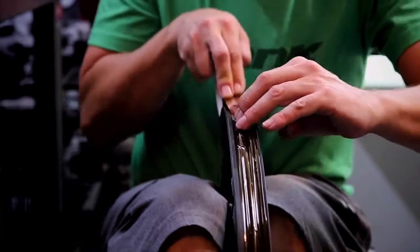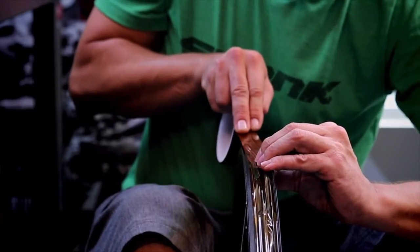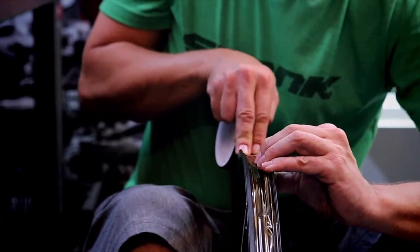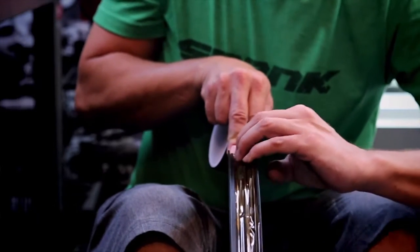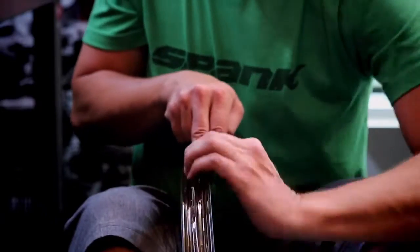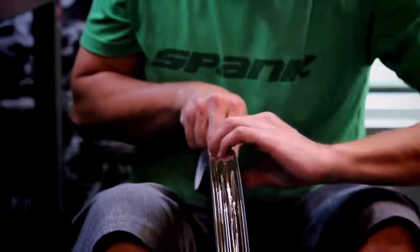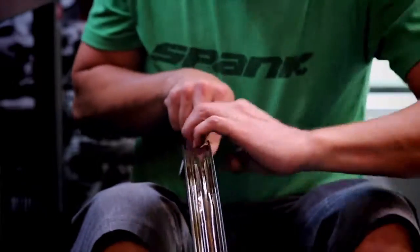Now as you approach finishing the first revolution around the rim, what you want to do is cross over to the left side of the rim and then tape all the way around in the same way, right to the vertical flange. What this is going to do is leave the tape double thick in the center where you're going to put your valve hole, with a single layer on the 2 sides to create a nice thin seal between the tire and the rim.